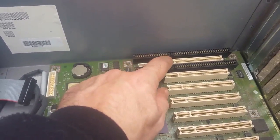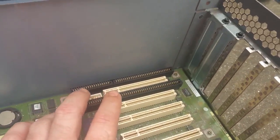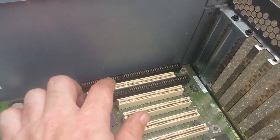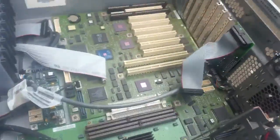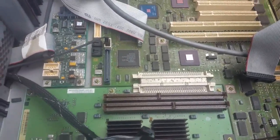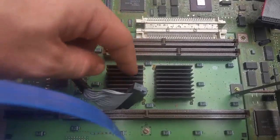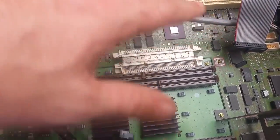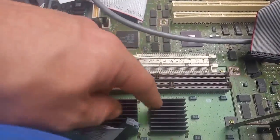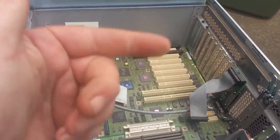You could have this slot and this slot, or this slot and this slot, but you could not have all three — there are only two physical spots available. You'll notice the interconnect bus between the PCI board and the CPU board, with some ASICs under there. It's individual modular construction — so if your PCI board failed you just replace that board, and if your CPU system failed you just replace that. Even though being IBM it would have been stinkingly expensive.